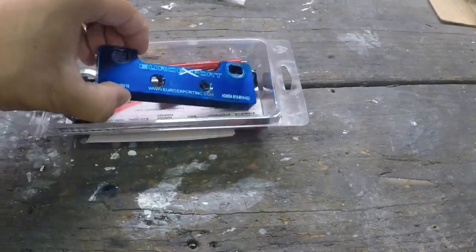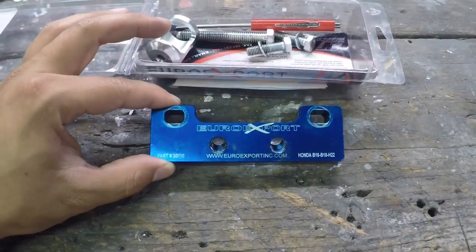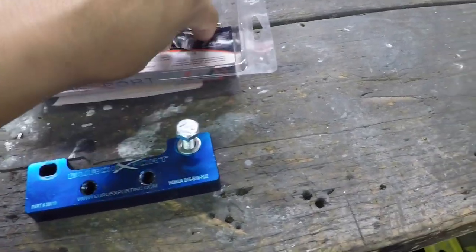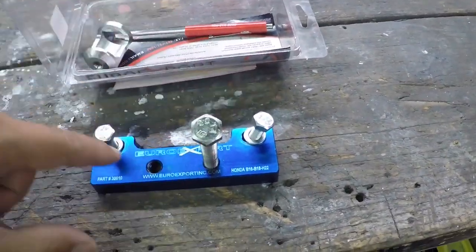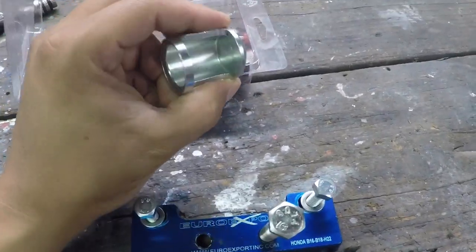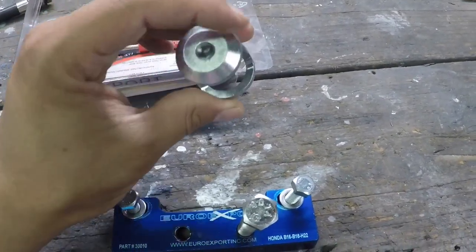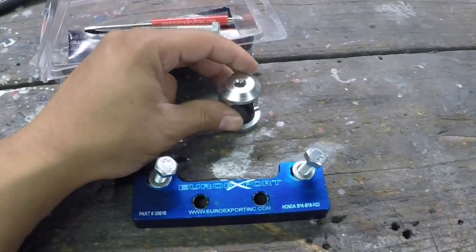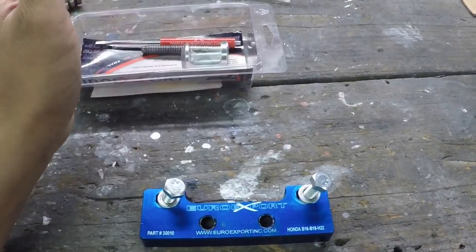So that's just some lube. This spring compressor here, I'll leave a part number in the description of where you can get it. This bolts onto the cylinder head where the cam caps went. So this will bolt on like so. This bolt will go in either one of these holes, thread down, pushing this cup. This cup has an opening where you can gain access to the valve keepers once the cup is pushed down using this bolt.